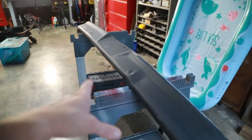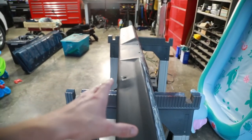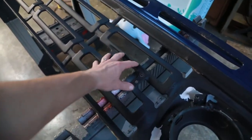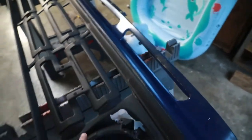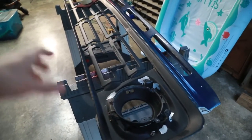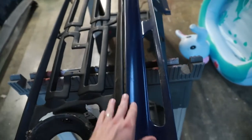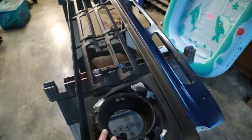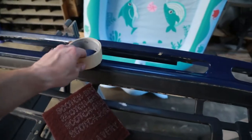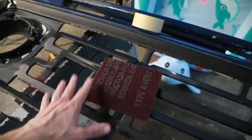I'm not going to have time to paint this tonight — it's starting to get a little dark. So I'm going to go ahead and bring the grill in here and get it prepped. All I'm going to do is rough it up with a Scotch-Brite pad. It is actually a grill for a 64 F100, because the fog lights sit in the grill itself instead of up here on the upper valence. Somebody at some point swapped this out from a 66 to a 64 — probably got in a wreck or something. I actually like the 64 more than any other truck. The hardware holding it on is extremely rusty, so it's safer to just leave it on and tape it off. I'm going to use a red Scotch-Brite pad to scuff it up and give the new coat of paint something to bite onto so we don't have too much flaking.